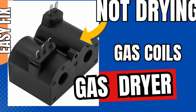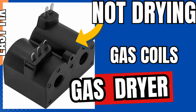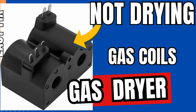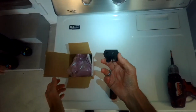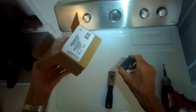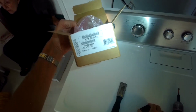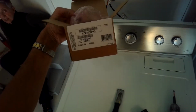Today we have a gas dryer that is not drying very well. It gets the clothes somewhat dry but not dry enough. So it's probably these gas coils right here that we need to replace for only about 25 bucks or less. Here's the part number here, but we will put a link in the description below to help out.